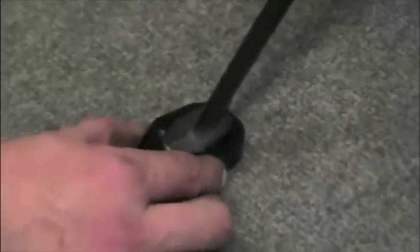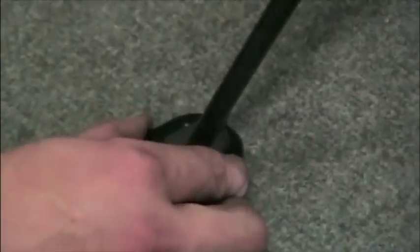I was really hoping to go through this and see a side stand that did not fit into the plate, and we would have to get into some filing down. However, what you can see here is our side stand fit into the extender very nicely, and as you'll see in a second, the bolts with a little Loctite held it on there very nicely.